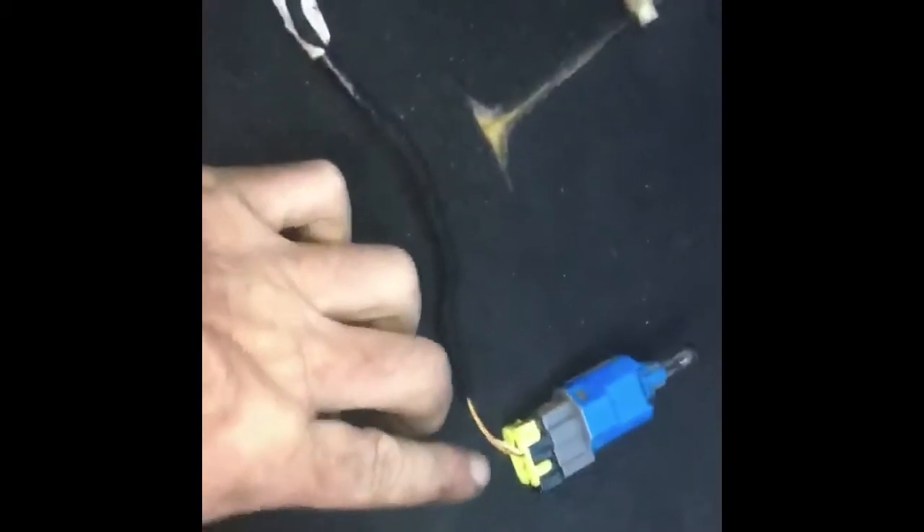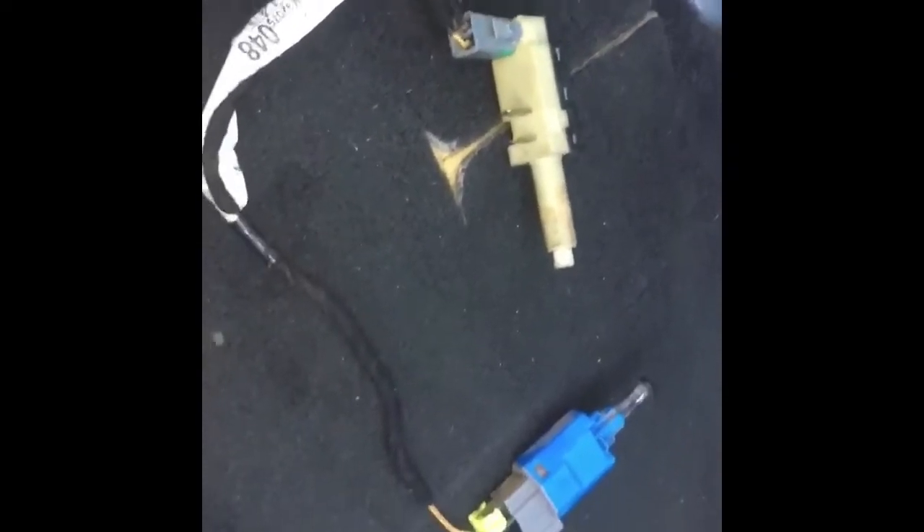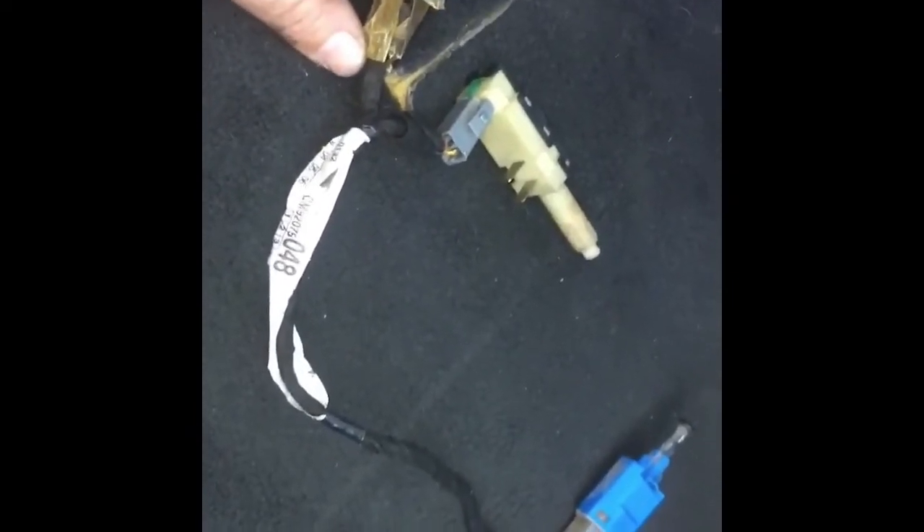All the pedals are in. The master cylinder shaft is in - circlip and washer - no dramas, everything's bolted up. I did put the V8 throttle cable in already - it's all in there. One thing I will note: normally the clutch switch is on the clutch pedal, and this is an extra switch that goes on the brake pedal - that's to suit cruise control. This car is full blown budget model with no cruise control, so there's no allocation for this wire. Normally pushing the clutch in will disable your cruise, and when you hit the brake that also disables the cruise. So I don't need them, but if your car does have cruise you will need this.